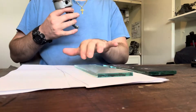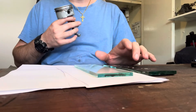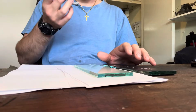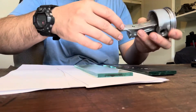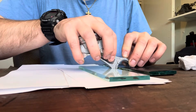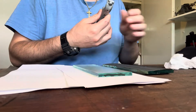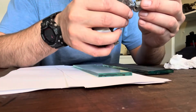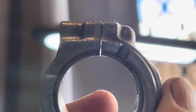It's getting late so I'll do the machining tomorrow. What I've done is elevated the glass block — which acts as my flat surface to register against — just slightly below the height of the abrasive block using paper, so we can creep up on the material removal. We want to remove material from the inside of the rod cap. That's starting to work — slow progress but we're doing it. Now putting it up against the cap — can you see how at the bottom it's opened a gap while at the top it's still flat, tight, and closed? That's exactly what I want.